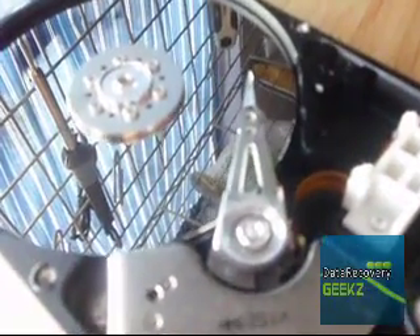On some drives there is a plastic piece called the keeper. If a drive has a keeper and the drive is dropped with the heads in the keeper, a lot of times they'll get stuck in there. But there's a lot of torque and force that happens, so they'll come back out, and you're going to get scoring when that happens. When the heads get all mangled in the keeper, they come back out and just drag back and forth across all the platters, just annihilating the data — causing a situation where the drive would be unrecoverable and you would not be able to get your data back.